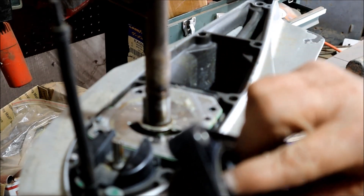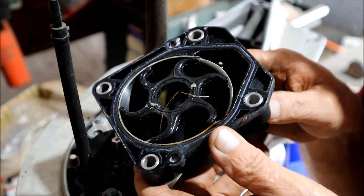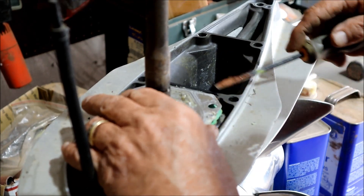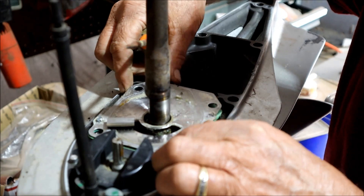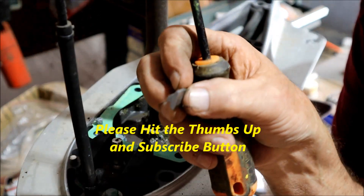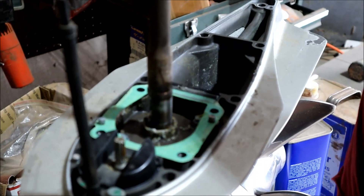There's your impeller. It really doesn't look that bad for being in there all those years, but we got it apart and we're going to replace it. Pull this little shield off here. A lot of guys just want to go in there and replace that impeller by itself, but if I have an option I sure want to replace it all. There's a little key way that holds the impeller in place. And that's about it as far as separating it. Next step is going to be to put her back together. See you next week.